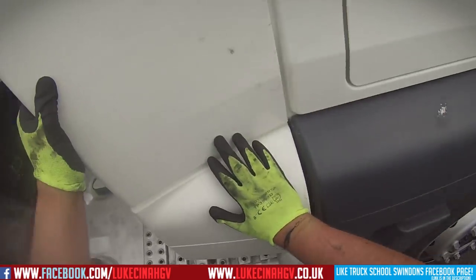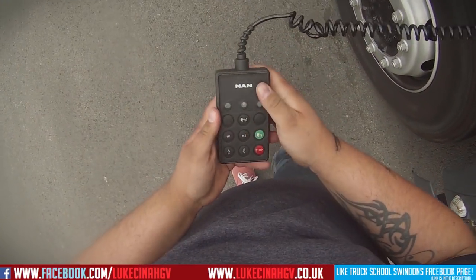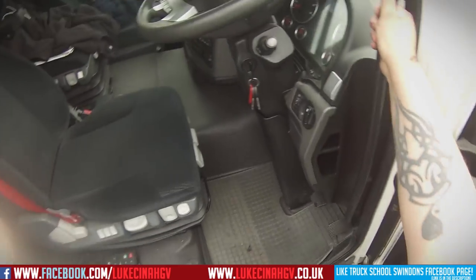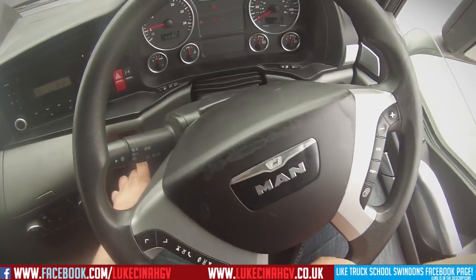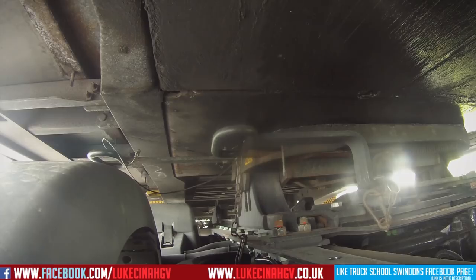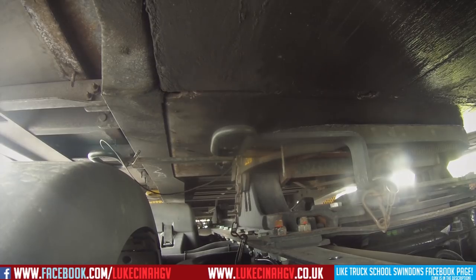Jump back down, put the fender back in, and raise the suspension. Whereas we put it down earlier to get out from under the trailer, we now put it up so the kingpin is in line with the trailer and we can go straight in and click in. I've raised the suspension, jumped back in, and reverse back into the trailer. I whack it in reverse and go back — there we go, clicking back in. In test conditions you do two shunts forward to confirm you're attached; I did a third because the first one wasn't very good.